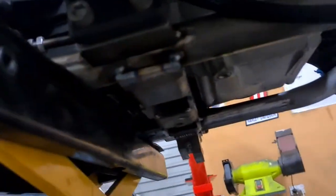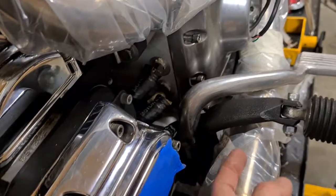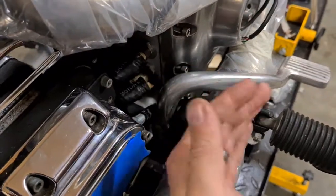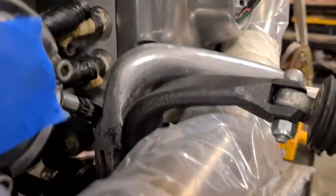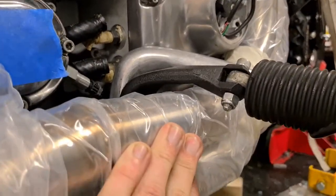The mid-mount braces — that removal brace I talked about last time has been welded in, and the Ramjet centerpiece has been tacked in as well. Once those were tacked in, that lets you put your foot controls in the right spot. The tricky part is making sure you've got clearance on the inside to your peg and also clearance from the top of your exhaust to that peg. Once you bolt it in you can only adjust it outward — you don't have lateral up-and-down movement. So it took me one or two tries to get it in the right spot with clearance everywhere.